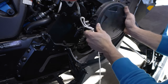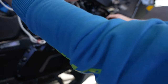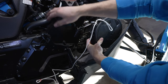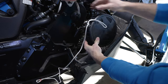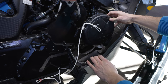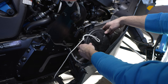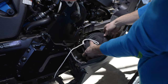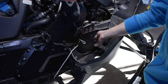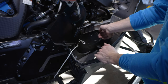We can go ahead and install our cover — the one with the recoil. The pull cord is going to go behind your chain case, going up, and we'll be installing the handle here — you'll be pulling it. So you want your cover to go like this: the Rotax is horizontal and your pull cord towards here. Go ahead and insert it in there. I twisted it a little bit clockwise when I was putting it in, and then it went in just like that.